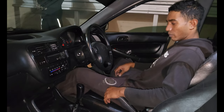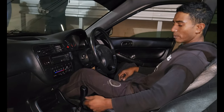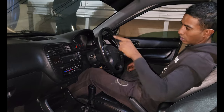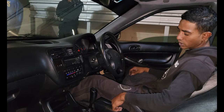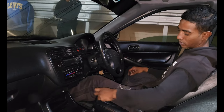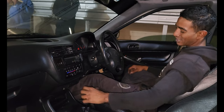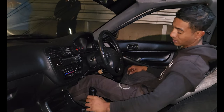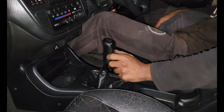Here's a brief demonstration of what we did on the Honda. We basically eliminated all the play — as you can see there, that is almost zero play. That little bit of play you see is basically inside the gearbox itself. We replaced the standard bushes with our polyurethane bush kits to get it to shift nice and solid, new like it came from the factory. Some of you will know that driving on this thing can be really really sloppy, but as you can see it's solid, it springs back the way it must, and it's quite easy to select.